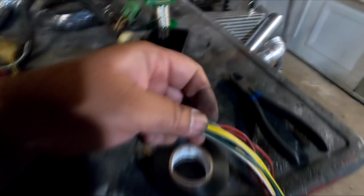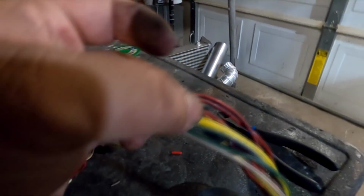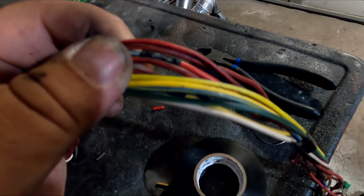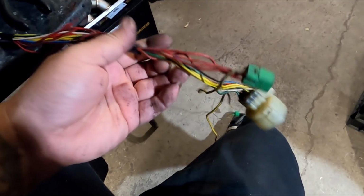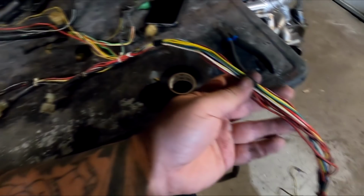I'm going to go ahead and knock that out quick. Don't want to confuse you with a lot of talking. I'm going to solder that real quick. Injectors are spliced in. We got the yellow to brown and red to blue, shrink tubed in place. Got the resistor wires, all of it routing all the way to the plug here, and electrical tape in place.